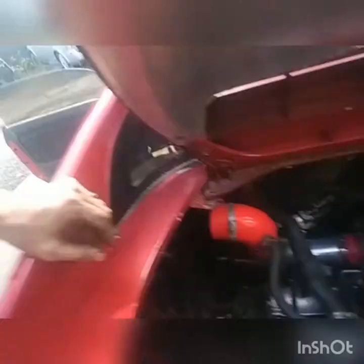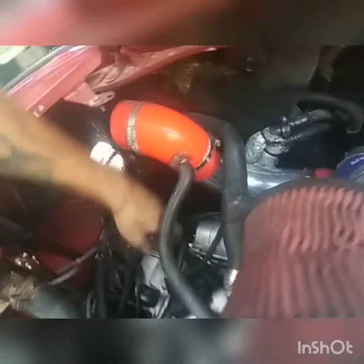I'm gonna tap and put that in right here. The biggest thing I got to do is the vacuum source, because on the MR2 you got to run it from the front to back here, instead of like a front-wheel drive or front-engine car where you run it directly to the front, which is really simple and easy. My boost controller is right here — I think I'm gonna just try to tap into that reference line and go from the side that comes from the manifold and see how that works. Hopefully that'll work the way I want it to. If so then I got an easy access point which will make it really great and really simple.